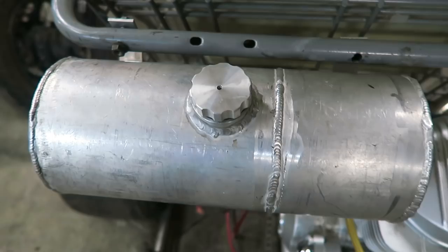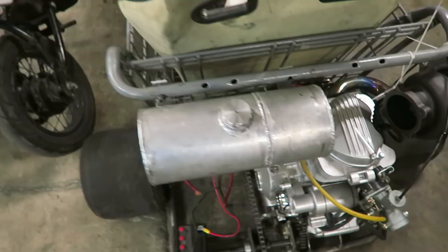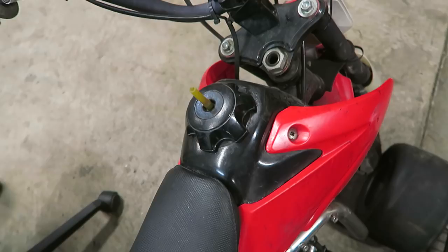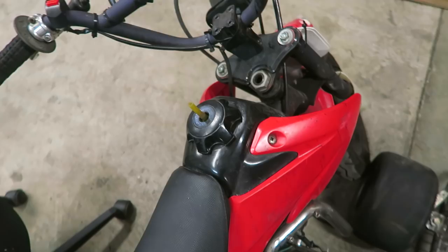For those of you telling me I need to put a vent in the gas can - I did just drill a hole through the cap, so that will let air come in and let the gas drain properly into the carburetor. I actually knew I needed to do that, I just forgot to mention it. A long time ago I used to have a little grenade-shaped valve cap on my pit bike, and I made it a couple miles from my house and all of a sudden it just died because it started to create a vacuum in the gas tank. Right when I popped that off it solved all my issues. So I learned that you need to have some sort of vent on the top of the gas tank or else it's just going to create a vacuum and not let the gas flow down into the motor.